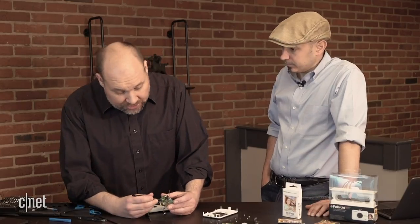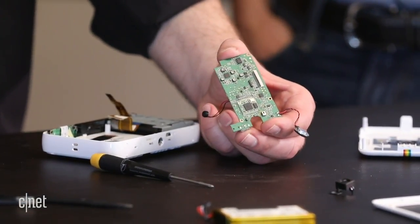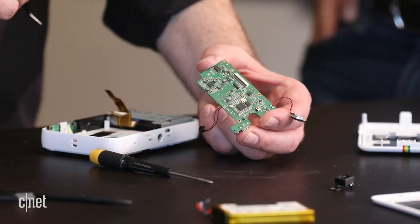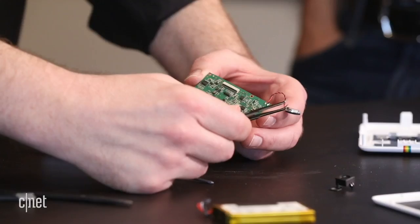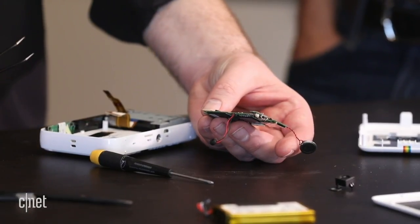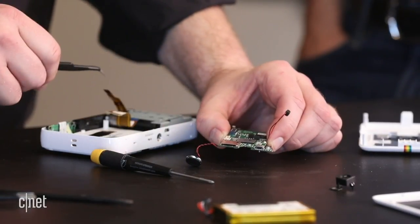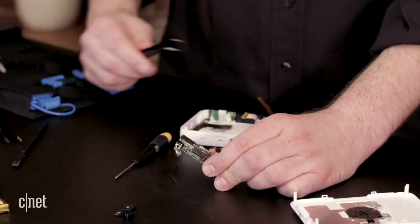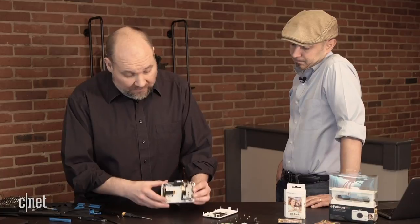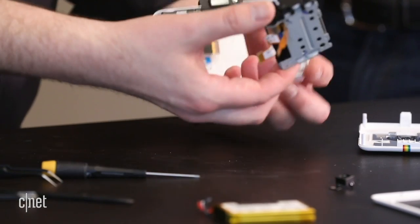Some of the smaller chips are really hard to see on the back. If I flip this over, there is an IS 1678 S Bluetooth dual mode SoC on this. There is a speaker at the bottom. You also have a microphone pointed to the front to record video. There's a micro SD card slot for external memory, a micro USB port, and a contact for the reset button. We're now going to remove the printer assembly — I opened the back door so it comes out a little easier, as it was catching on this little metal contact.